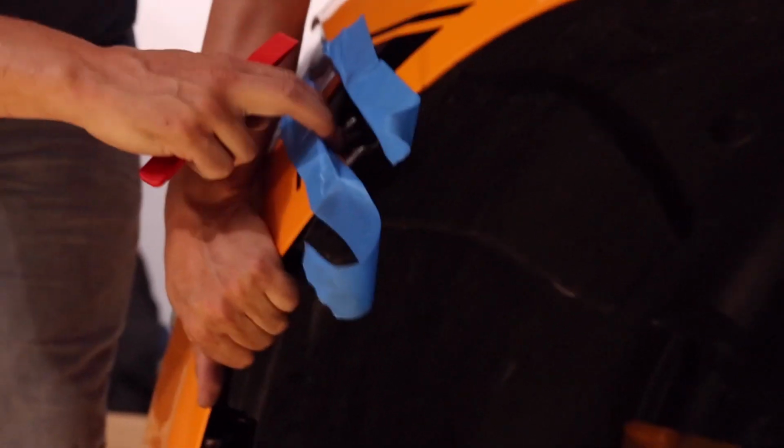And there you go. So here's where the two bolts that I removed in the fender well were, and right between them is that Christmas tree plastic fastener. So that's what we're trying to get off. All those little ridges on there get stuck on the metal, so you just got to kind of pry it down. So now with this one removed, I'm going to do the same thing on the other side.